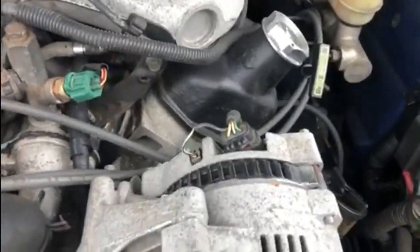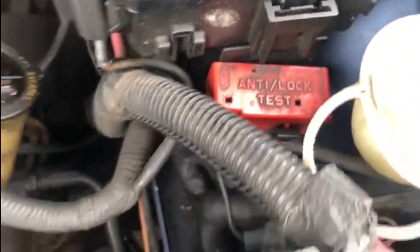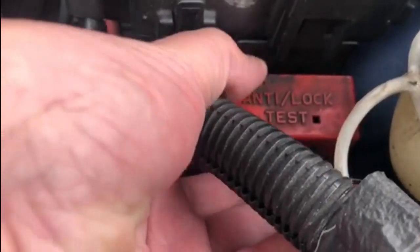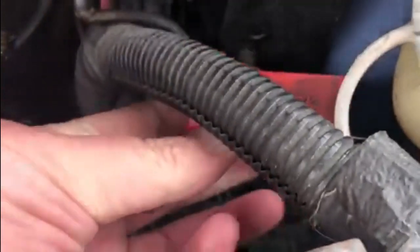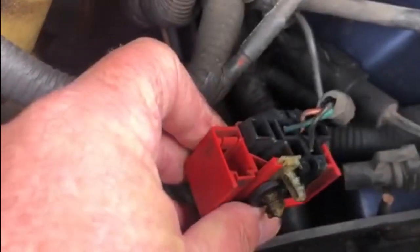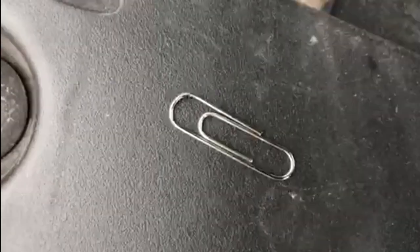On this '96 Mustang, the ABS system isn't checked on the OBD plug under the dashboard — it's checked on a dedicated connector under the bonnet, which even has 'anti-lock test' marked on it. To check it without going to a dealer and without a specialist OBD reader, just grab hold of it, pull it out of its socket, take it to one side, and turn it over. You'll see three wires — you want the black one and the orange one with the white stripe. You'll also need one of these — just an ordinary paper clip, bent into a U-shape.